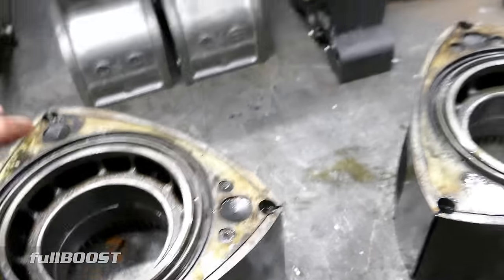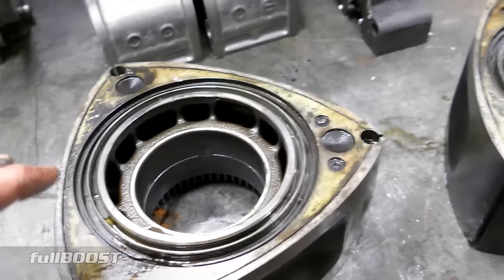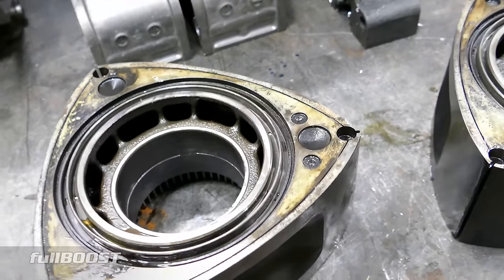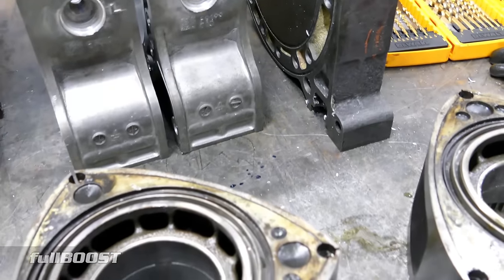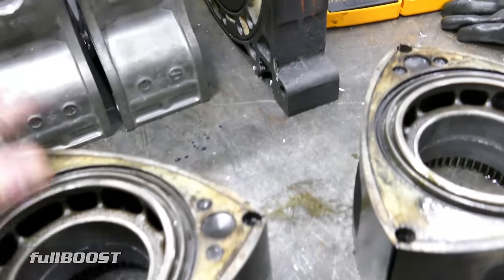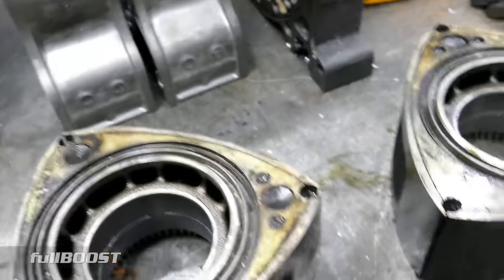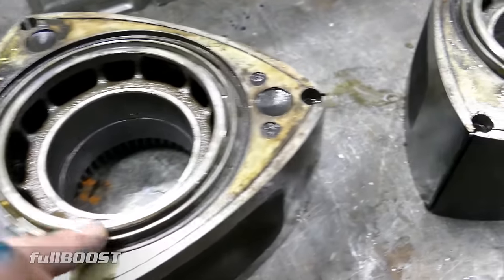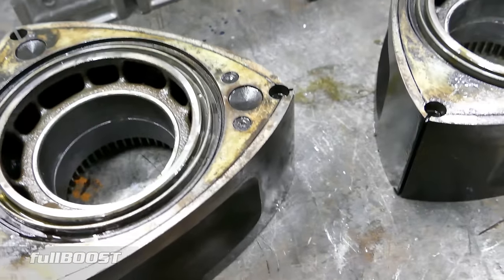It's going to be really hard to pick up on camera. This was the stock engine out of my FD. It was a turbo bridge port built by another workshop when I bought the car — it already had a secondary bridge port. But everything else in it was stock. When I stripped it down, it had that one issue down in the rear going through the entire engine. There was no race clearancing or machining in that. You can see what looks like light machining marks — that's more than likely because that surface came in contact with the plates.